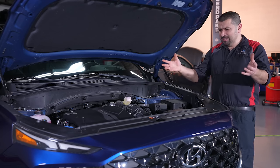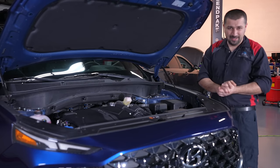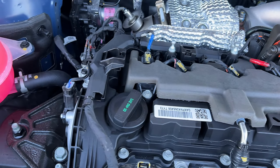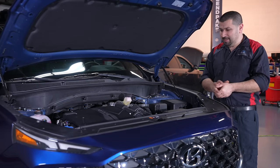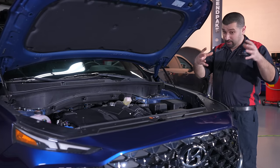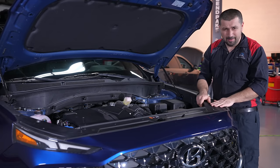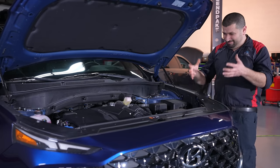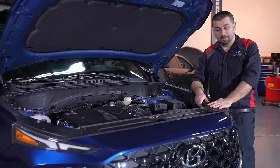Let's talk about some basic mechanical details. This engine has a plastic valve cover, which has become common in the automotive industry — cheaper and lighter weight. Then we move into the cylinder head, which is a two-piece design: you have the cylinder head where the valves are, and then a cam cradle that sits on top with a sealer in between. That's a very common design with modern engines and actually pretty good for service, giving some separation rather than cramming everything into one giant unit.